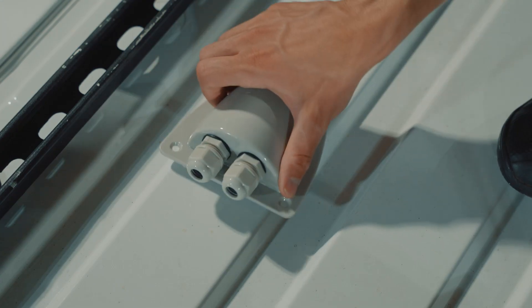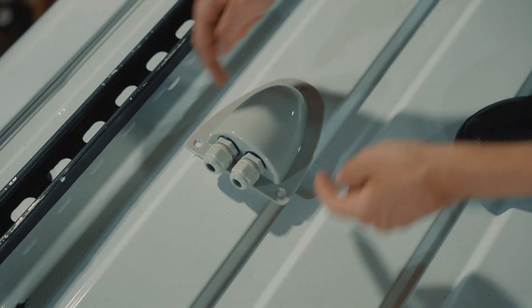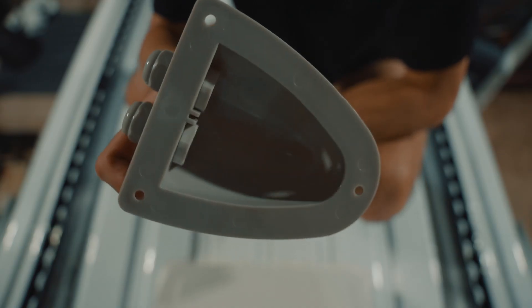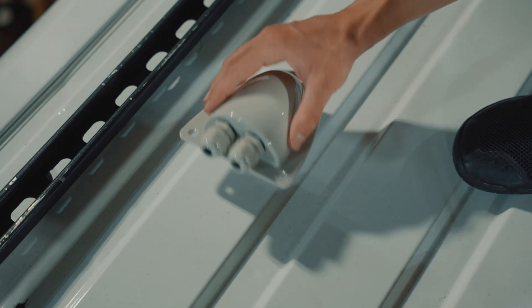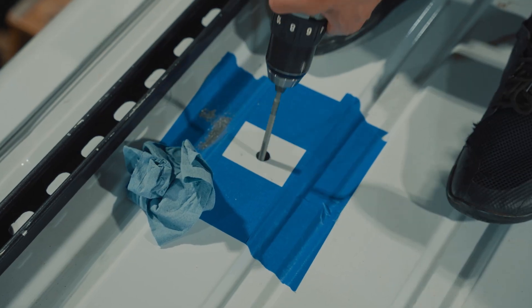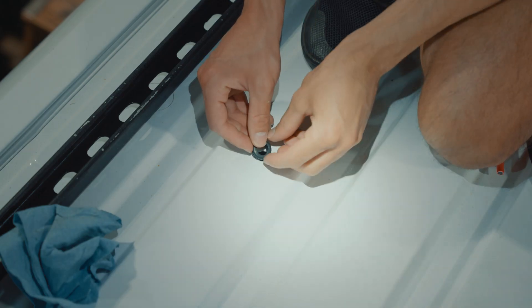Some people like to call this thing a gland box, but I like to call it a junction box. I placed it in a spot where water was least likely to get in — on top of one of the roof ribs, because water will mostly travel through the bottom. Unfortunately it's kind of awkwardly shaped and my roof has all these ridges, so there's no perfect spot where it can sit flush to the van, but I think this spot will be fine. First I drilled a hole, filed down the edges, hit it with some paint, and added a little grommet to protect the wires from the metal.